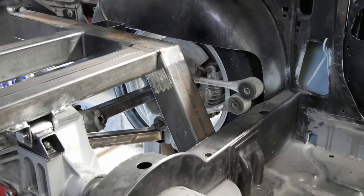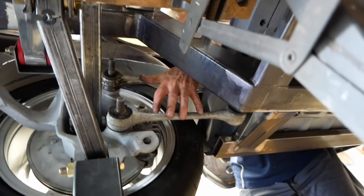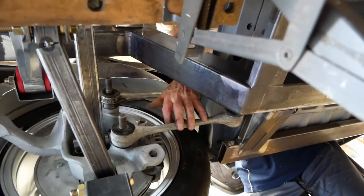As it so happens, the GT6 is very, very tiny, and we really don't have room for the longer arms. We do happen to have two complete sets to work with though, so we're just going to use the short ones. This obviously will change the geometry a little bit, but we plotted it out and it still seems entirely reasonable.